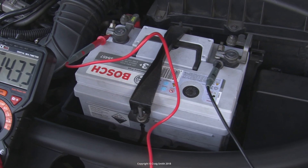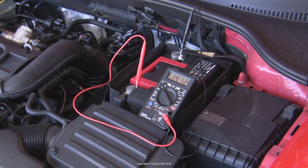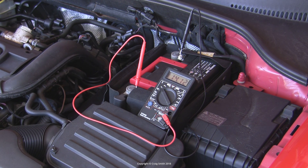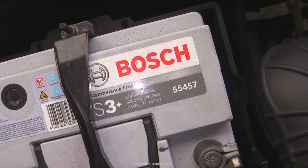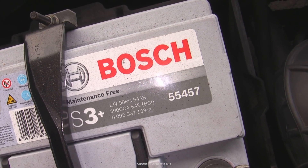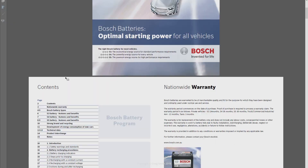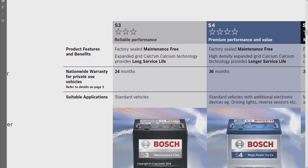In the case of overvoltage, it's likely to be something to do with voltage regulation. That could point to the alternator if it has an integrated voltage regulator, or it could be a separate problem to do with the car's ECU or external regulator, so depending on the car we'd be getting into some complications. On the topic of smart charging and calcium — or in the case of this Ford, silver calcium — batteries, double check that you have the correct battery type. If you install a classic lead acid type in these cars they will end up being overcharged on occasion because they can't take the higher voltages, and the batteries will be killed off much earlier than they should be.